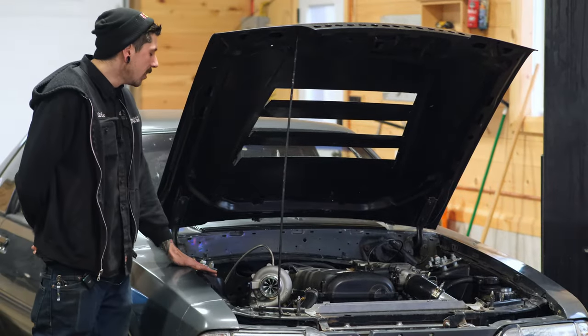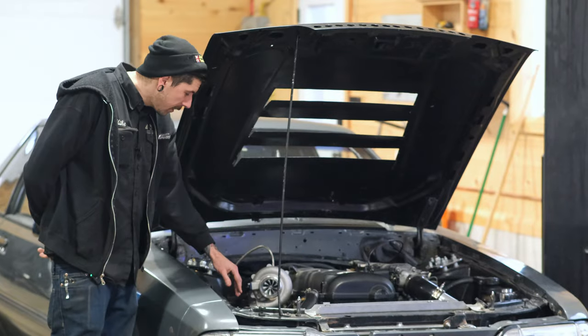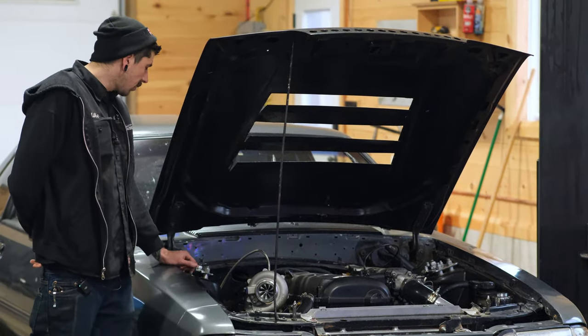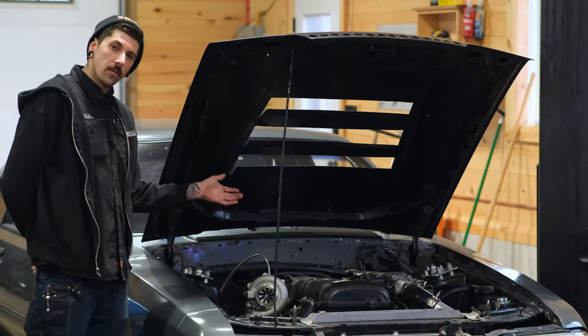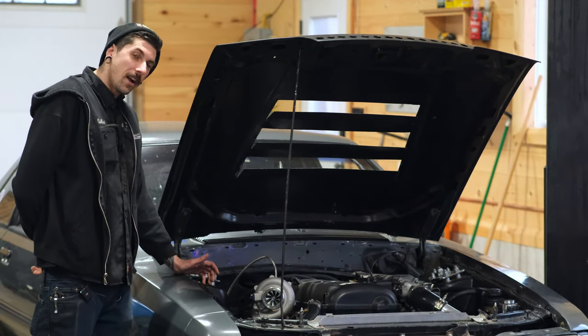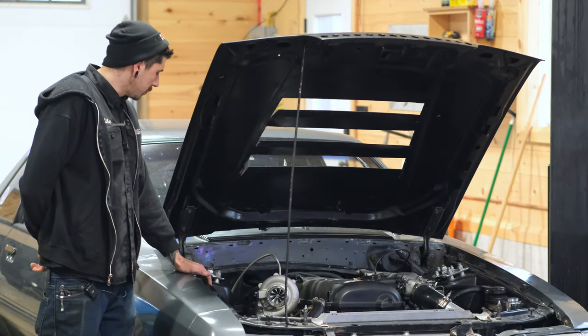So on the list, we have hot side intercooler piping, air intake. He's already figured out his turbo drain. Then we got to start making the downpipe and connect it back to the existing exhaust system that's on it. That also got damaged last year, so we're gonna cut out the section that he hastily fixed at the track. There's a bunch of goopy welds on, which is fine. You gotta do what you gotta do in the moment, right? So get all that out of there and freshen it up, tuck it up as much as we can.